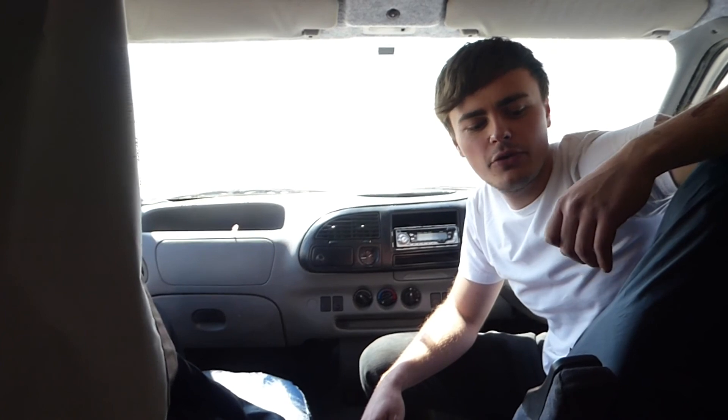If there are any drawbacks or downsides to installing an EGR blanking plate: I'd say that it makes the engine slightly more noisy, just because you've opened that flap, which makes it a bit more grunty — though it's not really a problem in a van like this because it's loud anyway. Also you've got the increased nitrogen oxide gases emitted out of the exhaust pipe. Thank you for watching, I hope you enjoyed this video and found it useful. Please like and subscribe, thank you.